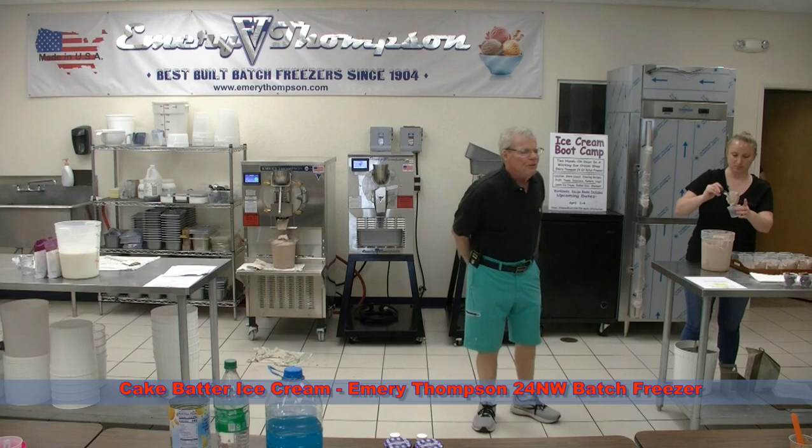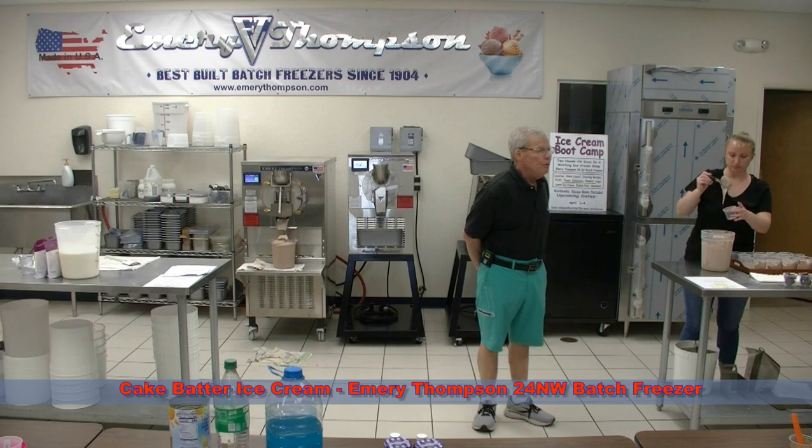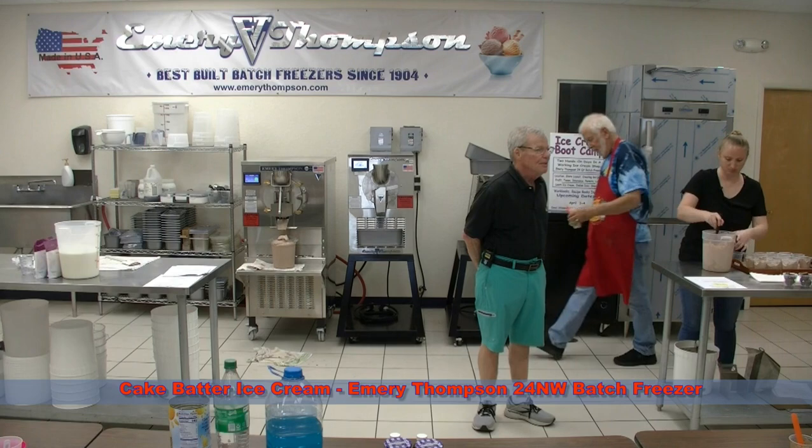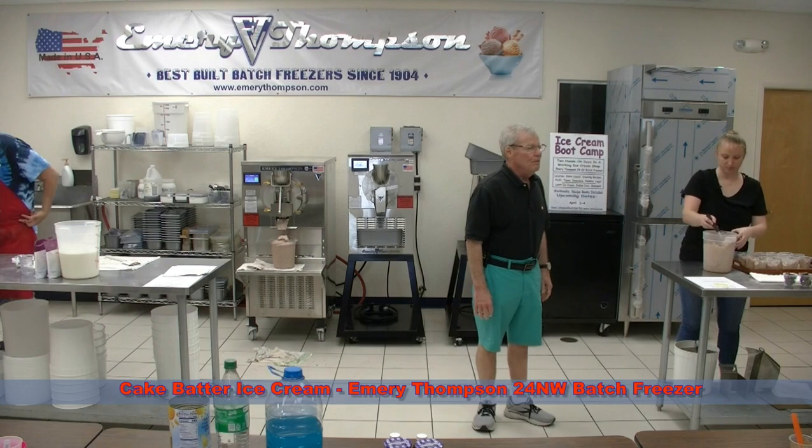If you put too much in, it's just going to take too long to freeze. It goes exponentially up. I get a lot of phone calls, and people say, my machine's taking 35 minutes to freeze. Well, how much did you put in? Well, it's a 24-quart machine, so I put in 24 quarts. Wrong. That's what comes out. So we have to answer that one a lot of times.